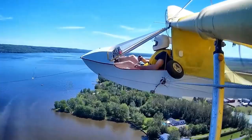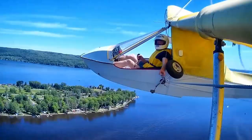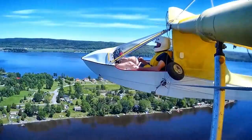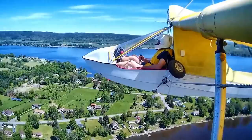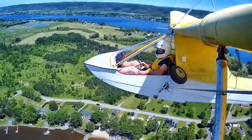If considering purchasing a used Buccaneer Amphibian XA, it is the ultralight flyer's recommendation that the plane's fabric be tested. The airframe, wings, landing gear, and the control systems should be thoroughly inspected. If the history of the engine is unknown, it is recommended that the exhaust be removed and the pistons inspected for wear and seizure. At the time of production of this video, the ultralight flyer would estimate the retail value of a used Buccaneer Amphibian XA from the 1980s to be between $5,000 and $7,500.